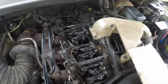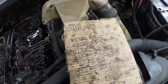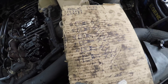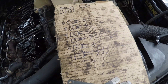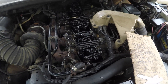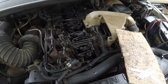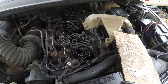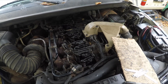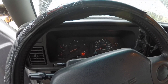I've lashed the valves, went one by one in the order I showed you, took a few laps around — double checked every cylinder, triple checked some. Everything is clearanced correctly now. I'm gonna clean everything up, toss the valve covers back on, and fire her up to let y'all hear how it sounds. Didn't take a before video, but some were way out — this is just preventative. Let's see how she sounds.